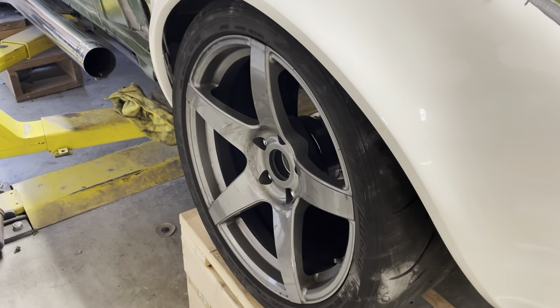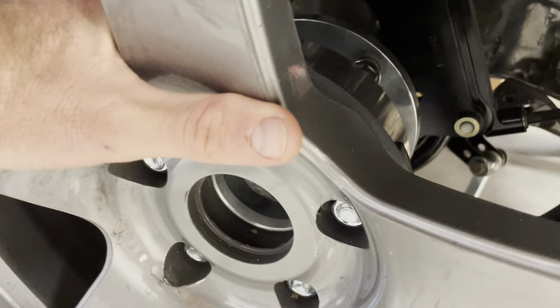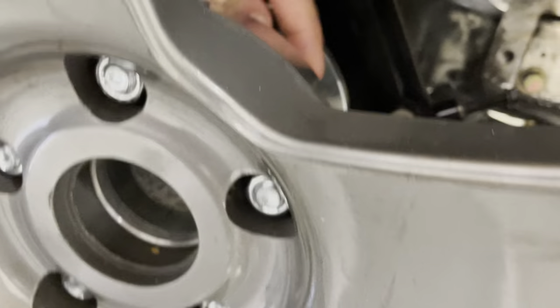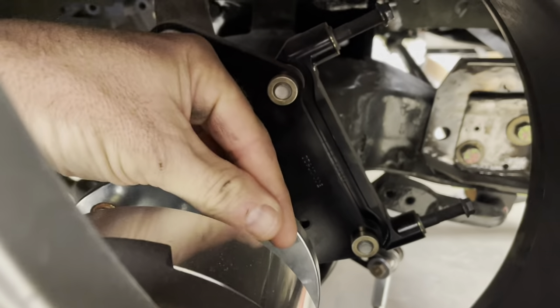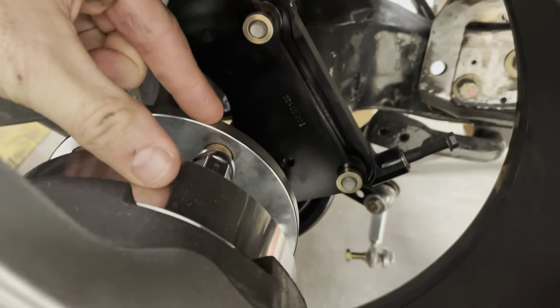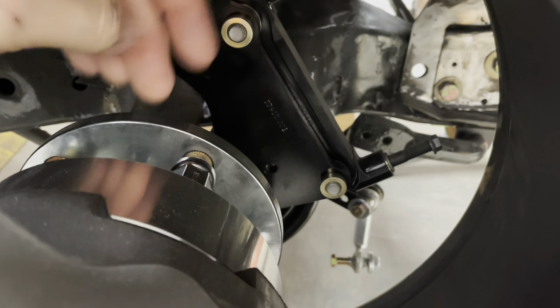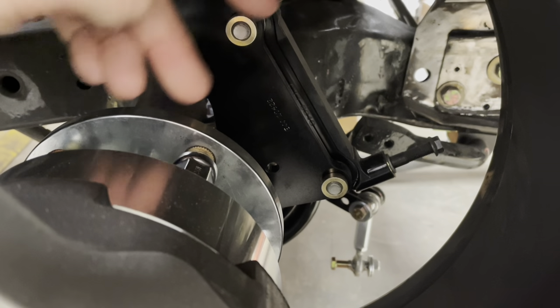Because the offset was so jacked, I had to purchase some spacers, and then I had to do a little bit of backyard ingenuity. I'm holding these off an inch and a half, plus the inch and a half spacer gives me three inches. I've got to do some math for the rotor hat.